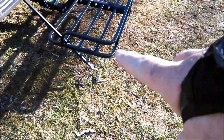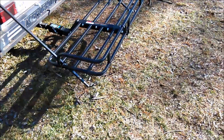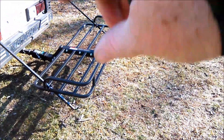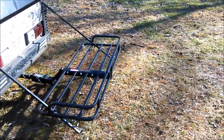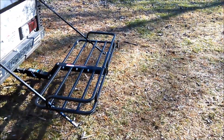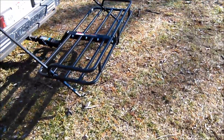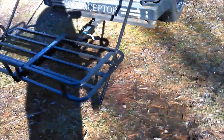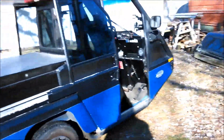So that is what we have been doing. I think we are going to take a little test. The bottom parts that are sticking out — I haven't cut any of that excess off yet because I want to see how much adjustment I really need and I want to leave myself just enough to lower it or bring it up to level depending on how the gopher rides when loaded. For now they are not going to drag the ground. I'm going to leave them on and cut them off later. We are going to take a ride — the first ride of the new year — just go around the lake and try this out and see how it handles. It's empty, but I just want to see.